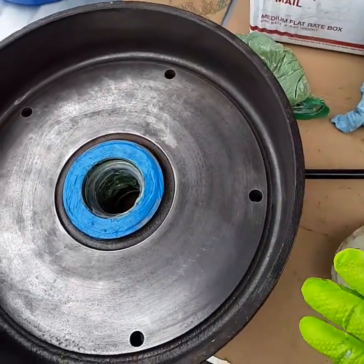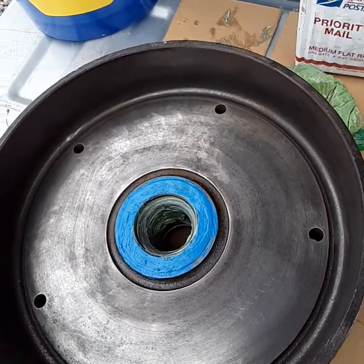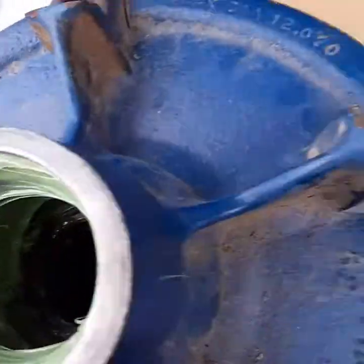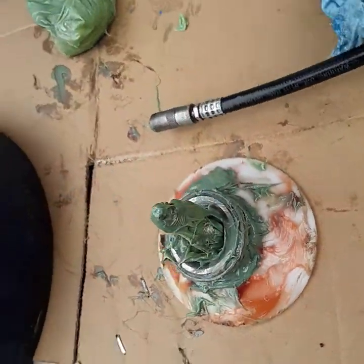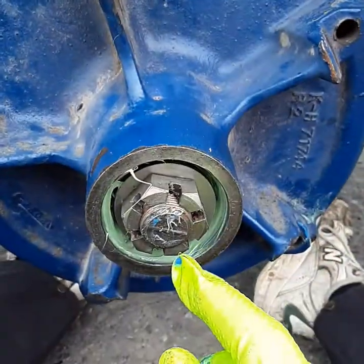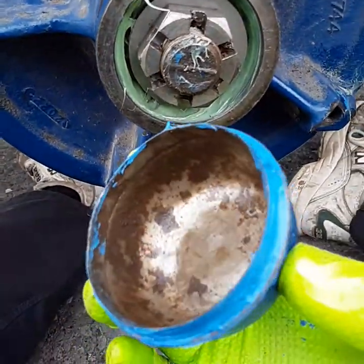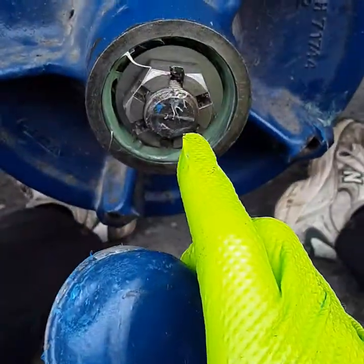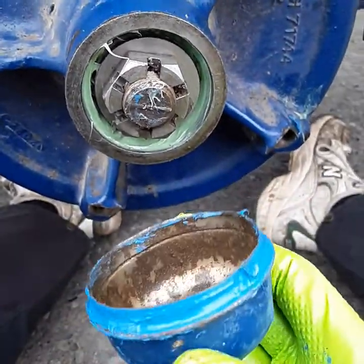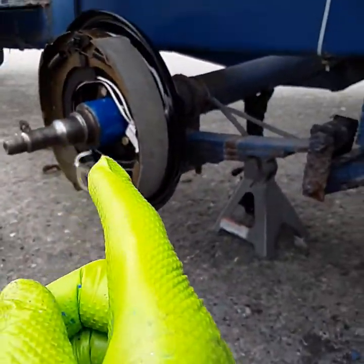It's a hard time to handle a camera, so I'm going to pause this video and get this one mounted up. I smeared some grease down inside there really good, got this bearing all packed up, and I'm going to get it mounted. I got the hub already mounted, so I'm going to tighten this down, get it snug and then about a quarter to half turn back. I got the dust cap all cleaned up — I'm going to put grease in there and pack a little bit more grease around the outside. I've got blue silicone on here to make this watertight, which is really important on a boat trailer — you need to seal up your hubs, or they'll end up rusty and nasty.